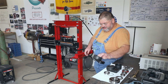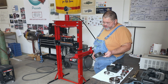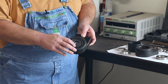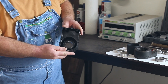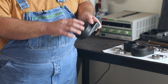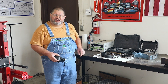What we're going to look at today is this center bearing that was returned to us damaged by a customer. This is from a '59 or so — a lot of years have similar parts. When they were trying to install the bearing and press it into the housing, they did not support it properly on the back side. You need to support this inner piece of steel. You can't support it out here because this is rubber, and what will happen is as you're trying to press it in, you'll tear the whole thing up. Let's go ahead and get set up over at the press and I'll show you how this is done.